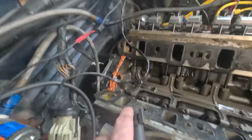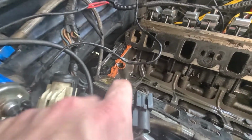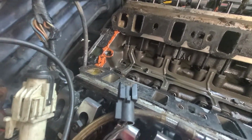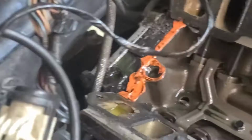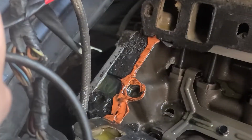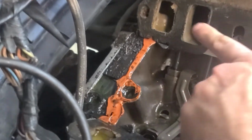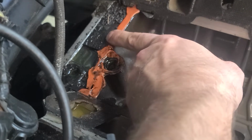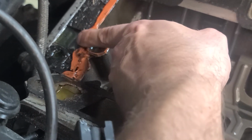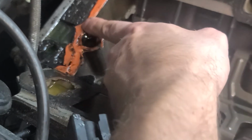The back is where it was really bad. I have a huge puddle of oil underneath the car right now, and I was like, rear main. But I'm looking at it, and there's oil all up high. So let me zoom in a little bit here, and I'm sure you're already seeing the problem. It comes along here and not terrible, and then right about here, there's a low spot in the RTV. I don't even know what this was doing.